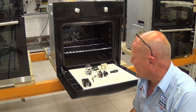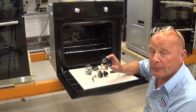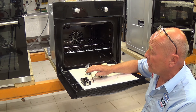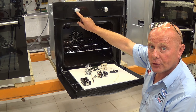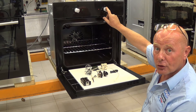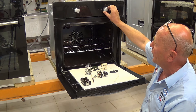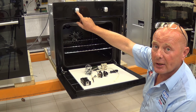The second most common fault with grills is not actually the thermostatic systems — it is the selector switch, which is not always used correctly. You should always select the selector switch first before turning the energy regulator or thermostat on. When turning the grill off, you should always turn it off first at the thermostat before turning off the selector switch. This will make the cooker last a lot longer.